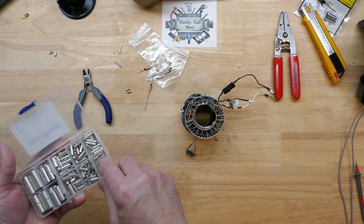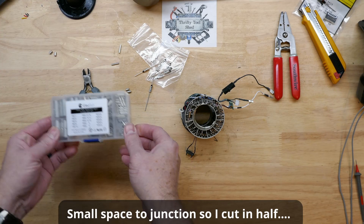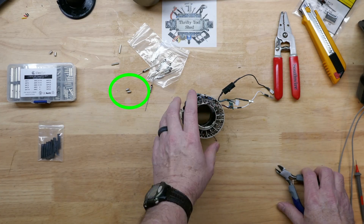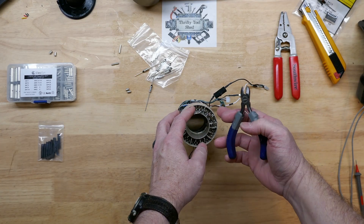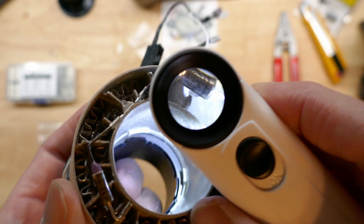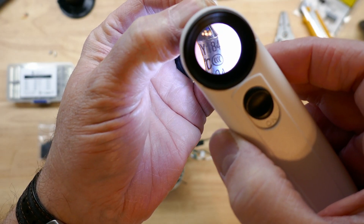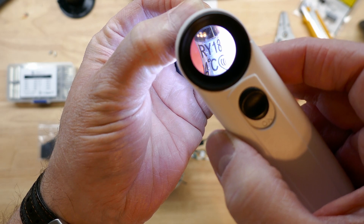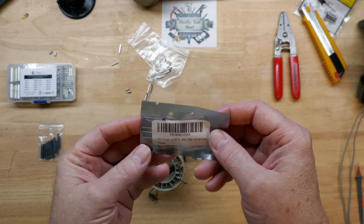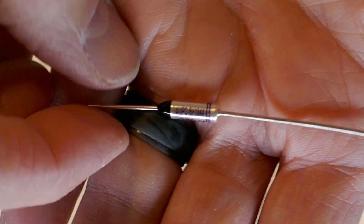I got some parts in, including my high-temperature connectors. The smaller size comes with some thermal fuses if you buy them in a kit, and they work well for inline splicing. I'm going to put two together, so I took the next-to-smallest size and cut them in half with the Dremel — I'll use these small rings to connect the existing leads with the new thermal fuse lead. These are 184°C fuses, and just so you know, I had some 10-amp rated ones, but those are cheaper ones suitable for smaller loads.